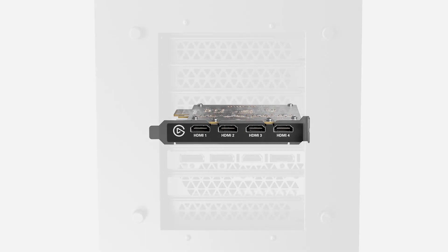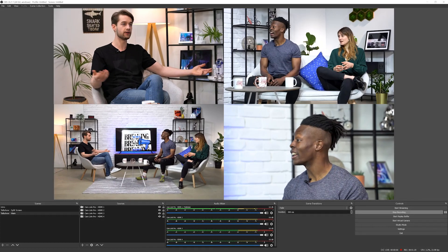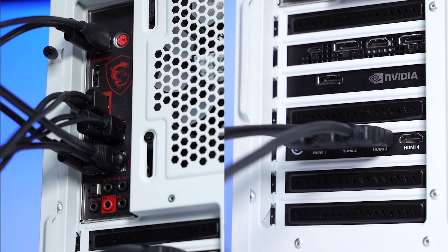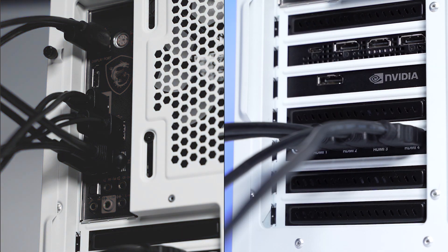This is why all of our pro capture cards are internal. When it comes to computers, they only have so many PCIe lanes. But because of PCIe's high bandwidth, you're able to send more data to your motherboard through one port than what you could send through a USB cable. This is where Cam Link Pro comes into play. Through its PCIe X4 connection, it's able to send up to four feeds of 1080p60 or 4K30 video to your computer through one PCIe lane. So if you're using multiple cameras, they can all just connect to a single Cam Link Pro resting inside your computer, versus connecting to four single USB capture cards where you could run into bandwidth limitation issues.